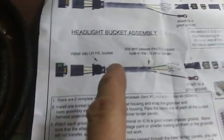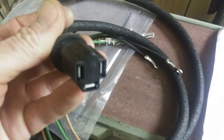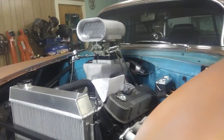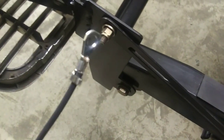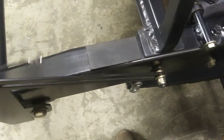Got the hood down. The next step is to put the headlight bucket assemblies in the harness - it's got a nice jacket on them and all the plugs ready to go. I'm gonna pull the headlight rings off, pop the glass out, stick them through from the inside, and put the headlights back in. Got the loom coming out of the headlight buckets with a nice rubber grommet and plug on the end. I gotta ground both - it comes with a ground but I may have to loop them together and ground to the main frame somehow.